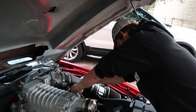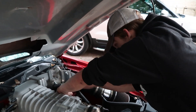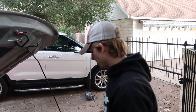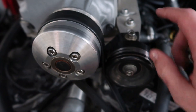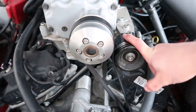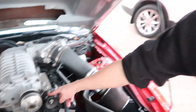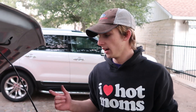I don't want to just keep tightening things — with aluminum, if you don't already know, aluminum is a lot softer than steel or cast iron. If you keep going it's going to suddenly go real loose, which I'm usually good at, so we're going to stop ourselves today. The belt is tightened and honestly I'm going to need to pick up a new pulley — that'll give it more surface area to grab the belt. You can see how easily it's slipping, so first let's run up to the auto parts store and throw on a new belt.